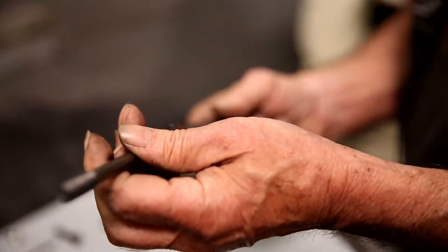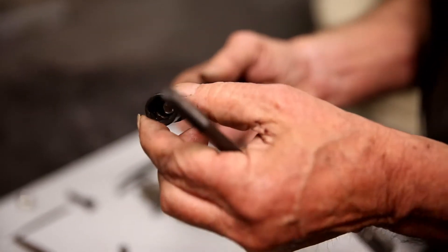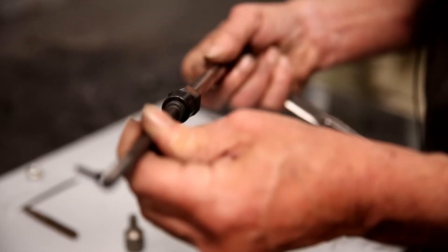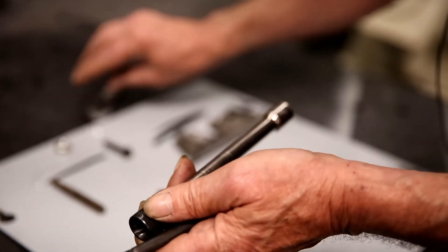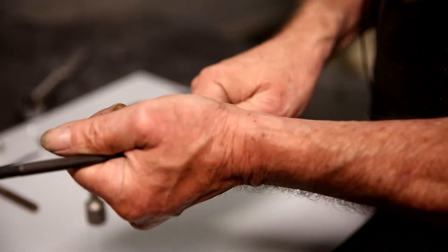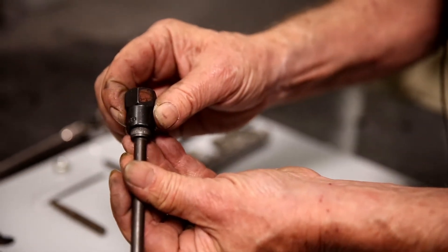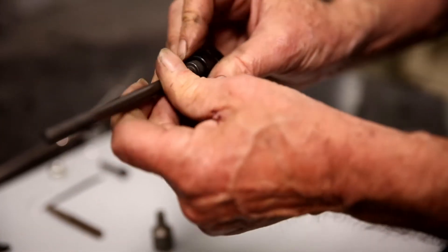You have to find the right size for the head. This is metric. If it were an inch hex nut, I would use the metric size for the nuts. Typically they only come in one, but nine out of ten times you can find one that fits. And if it's a little bit tight, a little bit of friendly persuasion with an aluminum bar — something you're going to hit this with — will allow you to get a good strike on it, and then it'll seat really well and grip the threaded screw to extract it, or the nut, or whatever.